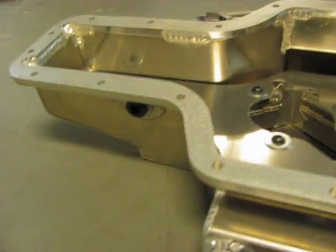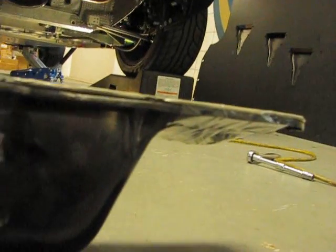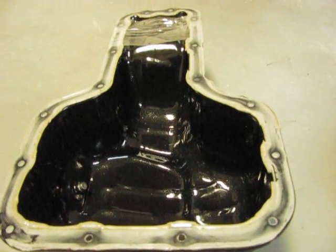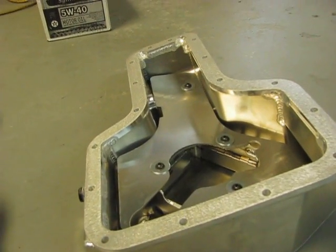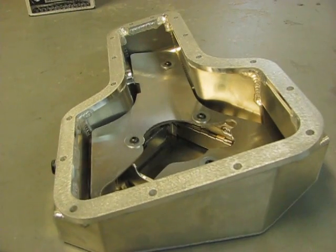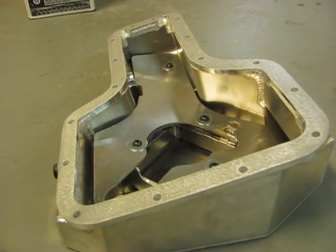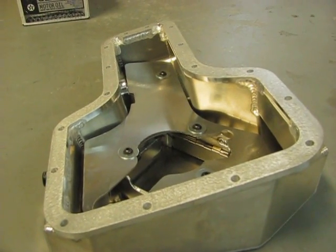You can also see that the Moroso pan has a deeper sump on that side where the factory pan really has very little. I believe the other Moroso pan is built the same way, and I think that's to clear the Celica or Matrix crossmember for that application. The other thing you can see that makes this Lotus-specific is the angle of the baffle in the pan. The 2ZZ motor in the Lotus sits at more of an angle than the Matrix and Celica, so the early Moroso pans marketed by one of the third-party vendors — the angle of the baffle plate really wasn't going to work fantastically for the Lotus because the angle was off.